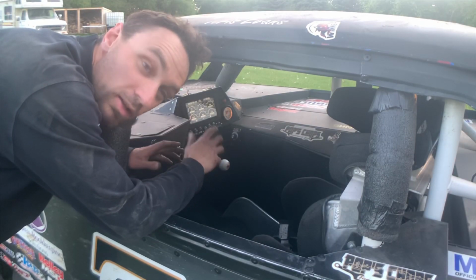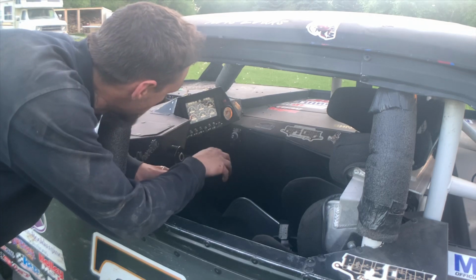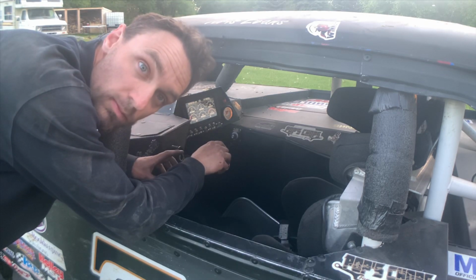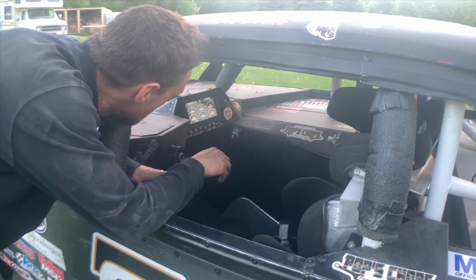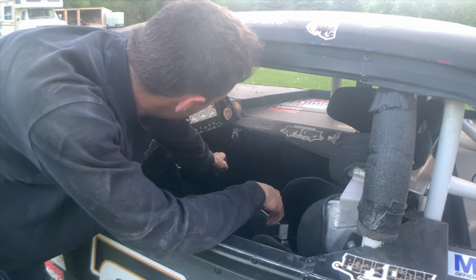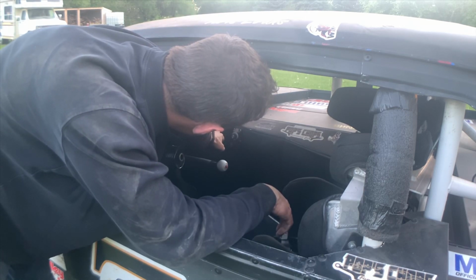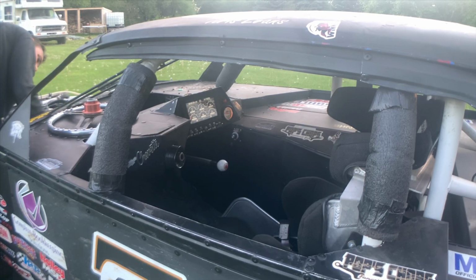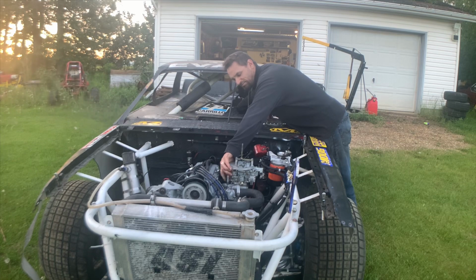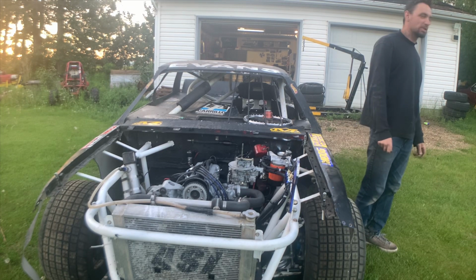All right, we're outside. Everything's powered up. First thing I'm gonna do is bump it with the starter and no ignition, see what we get for oil pressure again on the starter. Then I will prime the fuel system, check for leaks. Then, if I eyeballed my timing well enough on the distributor, we should be able to fire it. Let's see if I need the battery charger. I think I got the distributor in backwards.